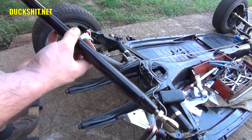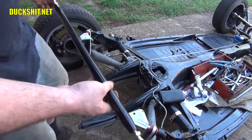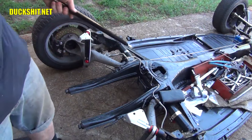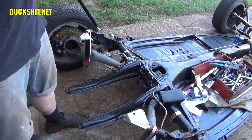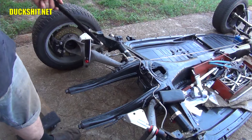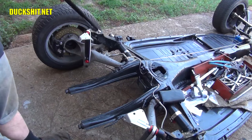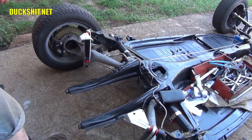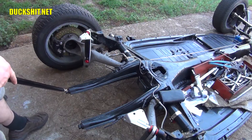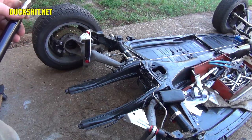You can already see how this is coming together. My story on this is I knew I wanted to buy one of these strut bars — and not just a 4-point, I wanted a 6-point. The reason is I cut up these shock towers and welded in a new backing because I completely shaved off the other side. I had to do that to make the spring plates for the 944 clear the shock towers. In doing that, there was a concern that I may have weakened the shock tower. So this strut brace will tie it all together to the IRS pivot point and to the transmission frame horn mounts — the whole rear end will be one stiff component.